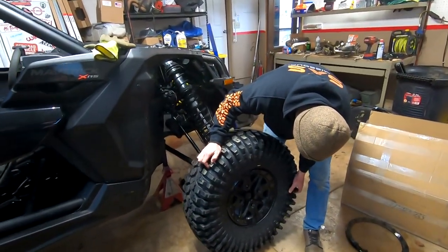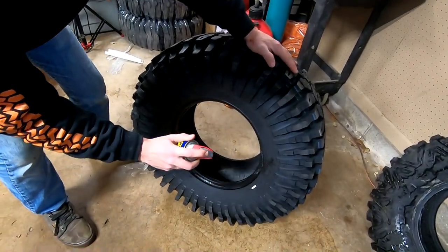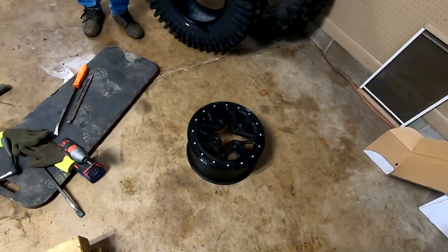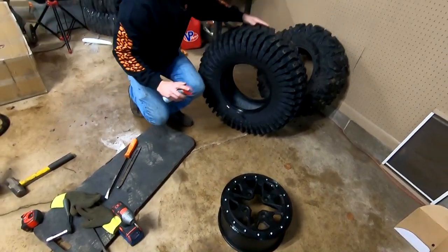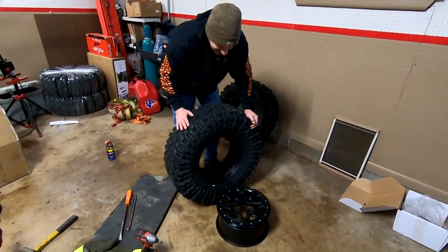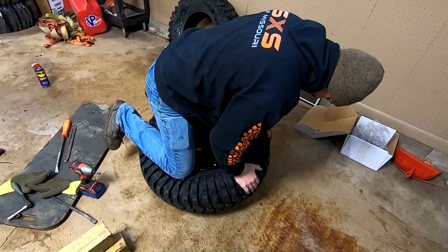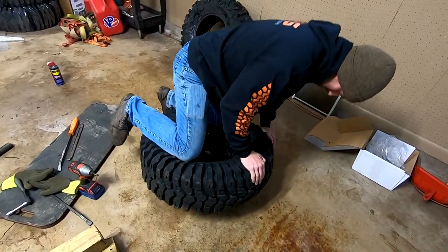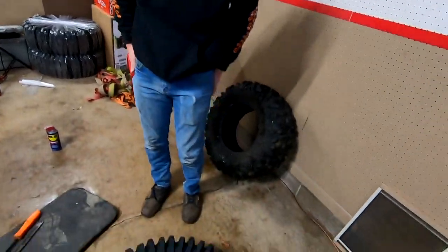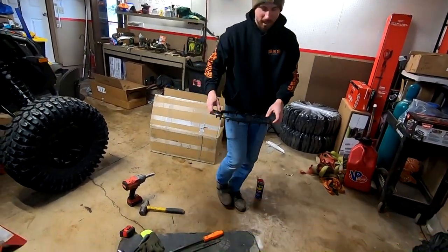We didn't really show this on the first tire, but we just lube up both beads - one on the tire and one on the rim - and Billy gives it a good launch and that pops right on, then you just tighten up the bolts for the bead lock ring. We'll give you an action shot of that. We got video of the one that was a bit of a struggle, but yeah it looks good. She slides right on and then you grab the old bead lock ring with the bolts still in it, line it up, grab the wheel and pull it up, then start some bolts.